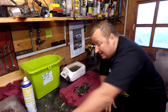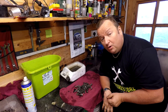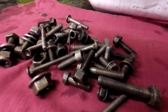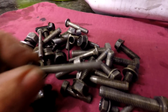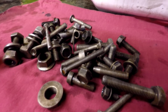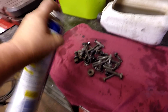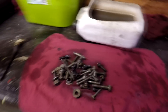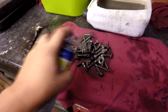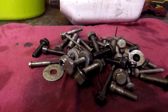It's taken me about 15 minutes to clean them up with a little wire brush. As I say, if these are nuts and bolts you can't readily get hold of, this is what they can turn out like just by soaking in vinegar. They've actually cleaned up absolutely fantastic and they're totally usable. To save these from going rusty again, I'll just put them in a little container, give them a soak with some WD-40 all over and a mix around, and literally just store them. Absolutely lovely — all cleaned up a treat.